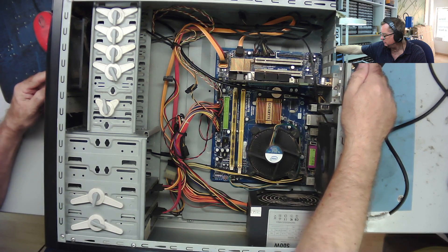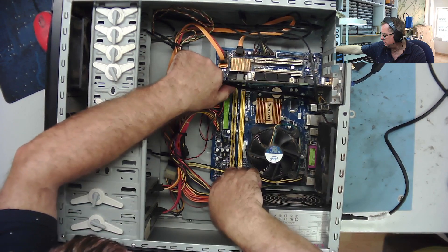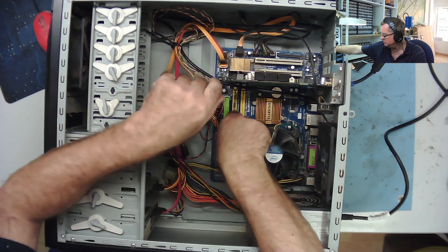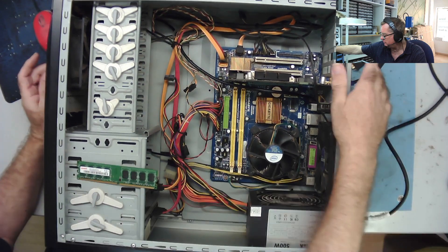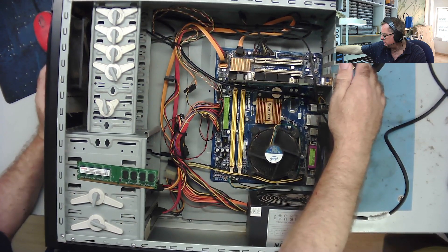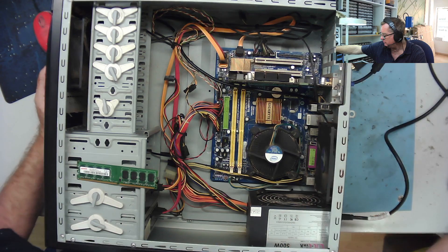It's interesting to see if it powers off if I hold the power button - yeah, it powers off. Let's try taking the RAM out and see if we can get some bleeps out of this without any RAM first. No bleeps - not even without the RAM connected in there.